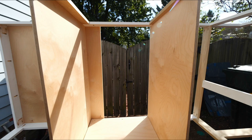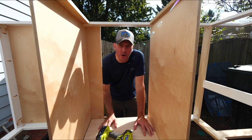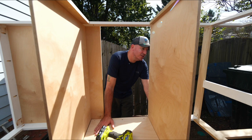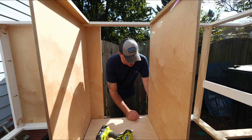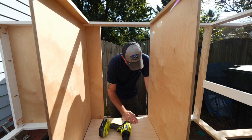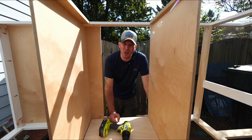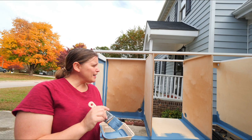Hi there, I'm where the refrigerator lives. This is going to be our compartment for our refrigerator, and we are going to need some ventilation. In a van you have limited space, so you have to get creative with installation. We have little vents that we're going to install with a two-and-a-half-inch hole saw. That way we can hopefully create a nice area of ventilation. The more ventilation you have, supposedly the less of a load and the less electricity you'll consume with your refrigerator.